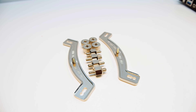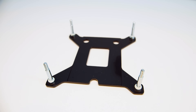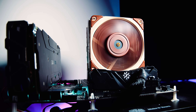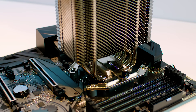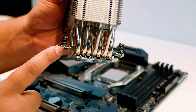Let's start off with what's in the box. It comes with mounting brackets for Intel socket 115X and 20XX sockets, and also includes mounting hardware for AMD's AM4 socket. It comes with a backing plate compatible with many popular Intel sockets, but we're using an AM4 socket board for all of our testing, so we'll use the stock backing plate that comes with the AM4 board. It includes two NF-A12 25mm thick 120mm fans and a tube of Noctua NT-H1 thermal compound. Installation is very straightforward — basically the same as many other tower coolers and should take three to five minutes. We did a comprehensive installation guide for both Intel and AMD, which you can check out in the top right corner. The construction is pretty nice and the heat pipes are very well placed. Noctua has also offset the cooler's mounting for better RAM clearance.